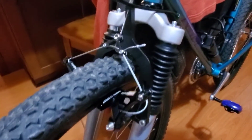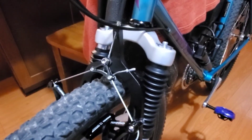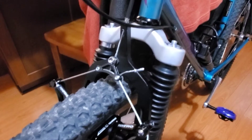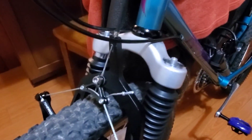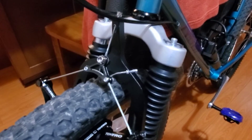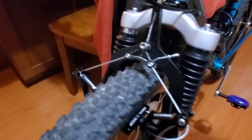Make sure your bike, especially the fork area, is nice and clean when you do this — that way you don't take a chance on getting dirt inside those stanchions and affecting any of the seals. Probably the easiest way to do this once you've gotten to this stage is to flip the bike over onto the seat and the handlebars. That way you've got a nice level platform and it makes it easier to take the wheel off.